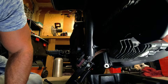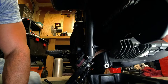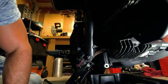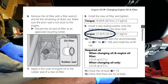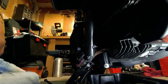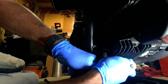While it continues to drip, I've already installed the new crush washer on the drain plug. Once it's done draining, I'm going to put the plug back. The manual specs call for 17 foot-pounds of torque, but I never put a torque wrench on oil drain plugs — I always just snug tighten it. On a motorcycle you can see it very easily, so if it's leaking you can tell. I just make it nice and snug — I don't want to strip it.